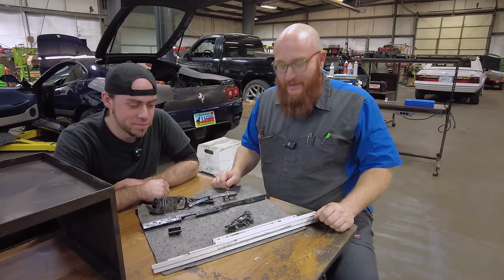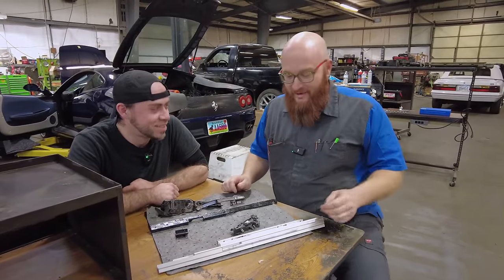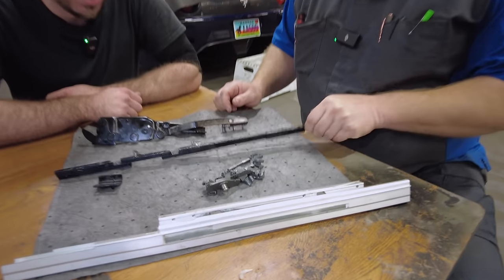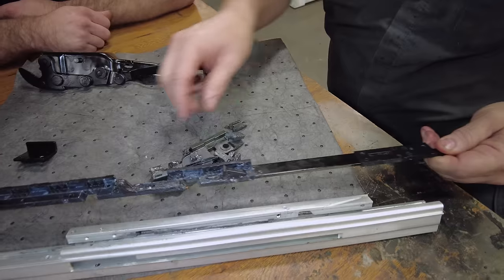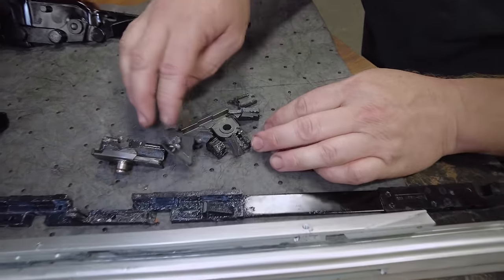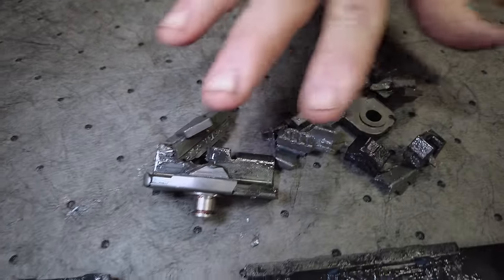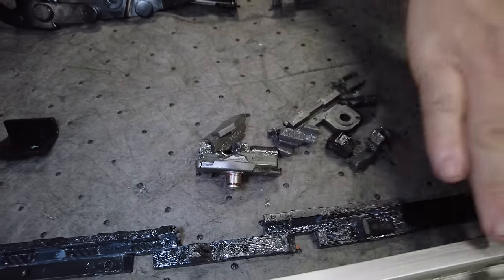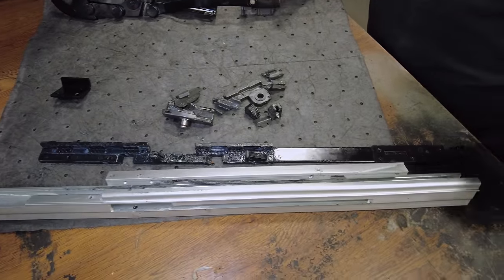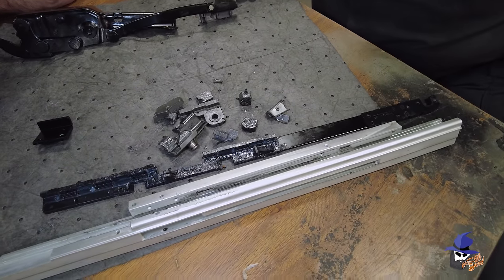Over at the cart, here's the track that was removed. A piece is supposed to slide inside the track and connect to various things. But look at these slides — they're broken into pieces. These broken plastic slides are what allow so much play and movement in the upper roof section; it should be nice and tight and close smoothly, not flop back and forth.